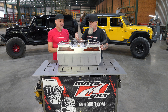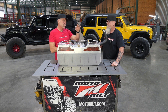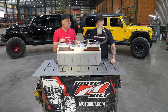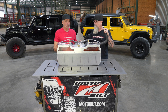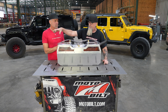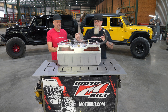A lot more of the issues people are having is on side hills — when the Jeep's leaning really far over to the side and the tanks turn really far to the side, where on a full tank setup the fuel is forcing itself through the vent tube back into the EVAP system. That's where we've been hearing from a lot of people online: they're having issues with the EVAP sucking in fuel. It's because of improper routing of the vent tube. Typically what we see is they'll run from the vent straight out and plumb into the EVAP canister, which sits about 18 inches above — but if you're on a side hill, it'll run right into it, fill that EVAP canister, and you don't want that.